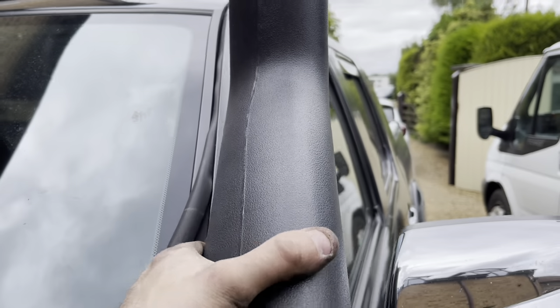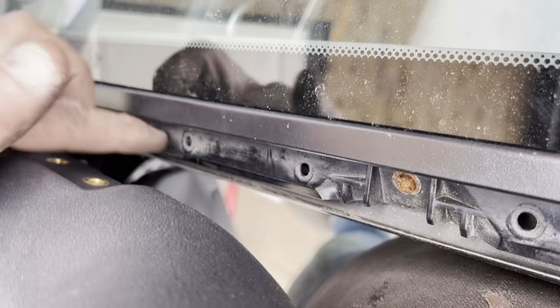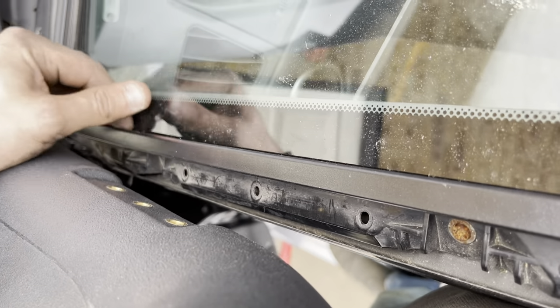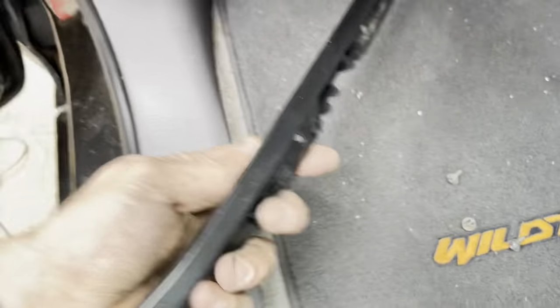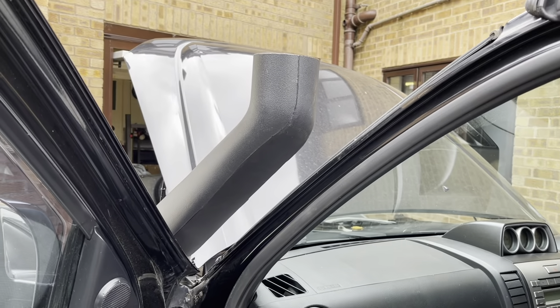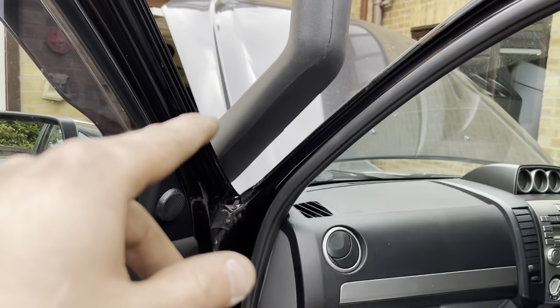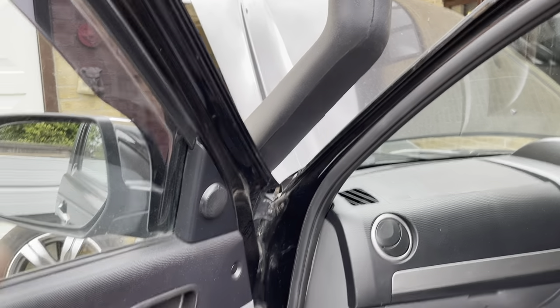Let me work this bracket because I don't understand this at all. For a start I've got to take this windscreen edge off because I think you have to drill it underneath. There's one bolt missing anyway. Let me get this off and have a look because I'm really lost. When you're doing the snorkel dry run — like I always do, I always give everything a dry run — take this piece of the edge of the windscreen off first because you struggle to get back to it. Looking at it, I have to drill holes in here somewhere. I hate drilling holes in bodywork. So I'm giving it a dry run, then we'll bolt that bit on properly, mark it, take it all off, drill all the holes, and then we're going to paint all the holes we've drilled so we don't get any rust issues. I think it's going to look alright.